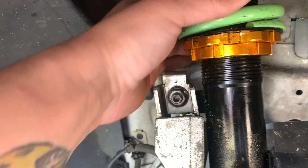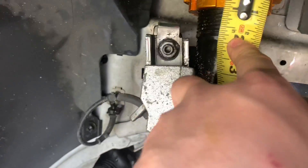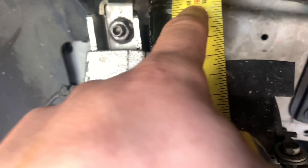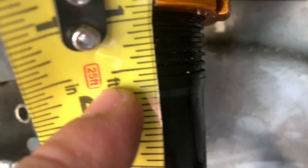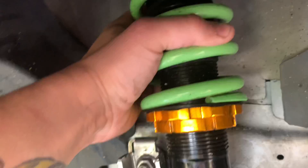1.5 inches is what we wanted — we had it at 2 and I still want to keep the coil tight with the spring. It just got a little loose, that's alright, we won't worry about it. I dropped it down here — from back here it's at one and a half. When we push it up it comes right under a couple notches at one and a half. That's where we're going to leave it. I'm going to tighten it up — it's not too free like before when I could wiggle the spring. We're going to see how that rides.